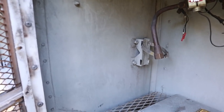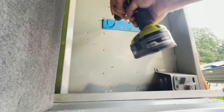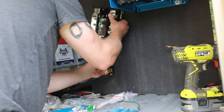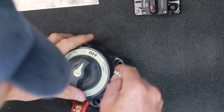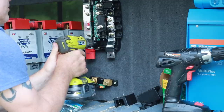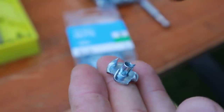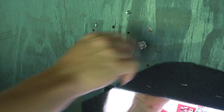We'll include links below in the description for our batteries and all the components we're using. We are affiliates with Battle Born Batteries, so it's an easy way to support our channel by using these links if you're making any purchases for your electrical system. We have two Victron 12/3000/120 inverter-chargers — Battle Born recommended these for our system so we'd be able to power not one but two air conditioning units in the bus. The inverter-chargers are substantially heavier than the other equipment, so we went ahead and used two-by-fours to build some structural wall support.